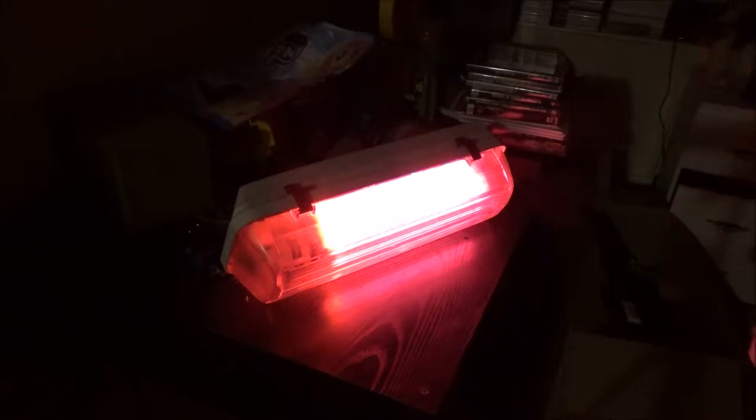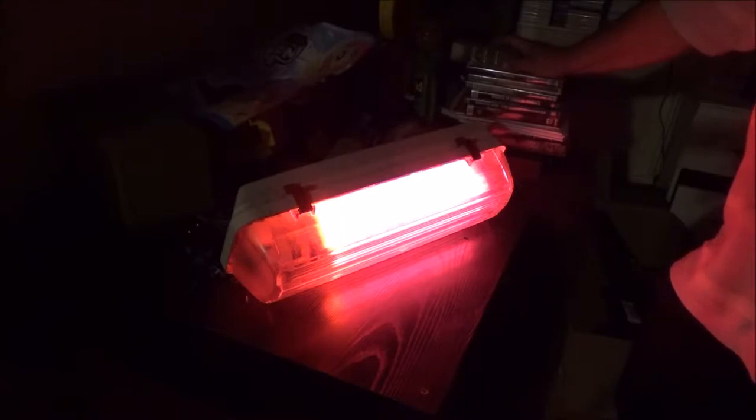There we go — you can see it's already glowing orange at this end. I will warn you though, it does get rather bright. It's glowing relatively bright just for being in the red phase. Moped progress: it starts! I ordered a part last week — it arrived last Saturday. The part I needed was a vacuum valve, which I fitted to the bottom of the fuel tank. I connected up the two pipes: one's a fuel line, one's a vacuum line. I hooked up the battery charger, hit the start button, and about five seconds later she fired straight up.